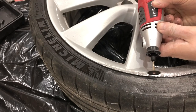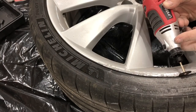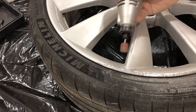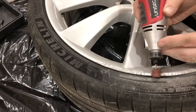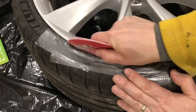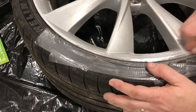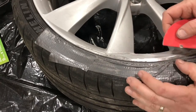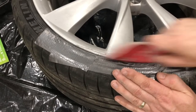I thought the cutoff tool was the easiest option since it's really small and not a very large area to fit in — I needed something that would fit in that space and give me a nice flat edge on the inside of the wheel. I'm just taking off that little sharp edge, and I'll be going over it shortly with sandpaper to flatten and round the edge off even more, getting it as close to factory as possible. The Dremel is using 80 grit sandpaper, which is by far the most aggressive sandpaper for this job, but this is the deepest gouge so I needed something to take the material off fairly quickly. Now that the Dremel has taken care of the bulk of the work, we move back to hand sanding with a little more finesse. I'm using duct tape to protect the rubber — primarily because it's a heavier tape; it lasts a little longer before you sand through it as I'm going over the edge.